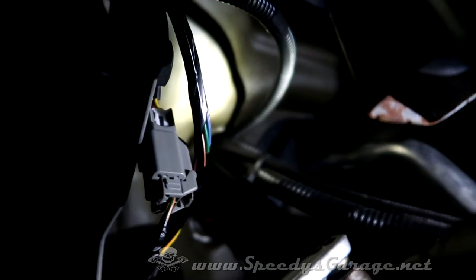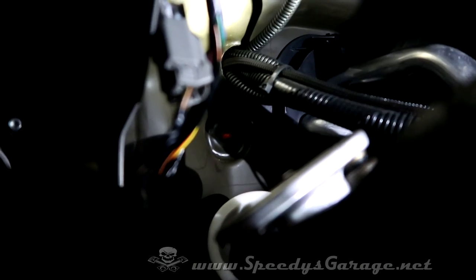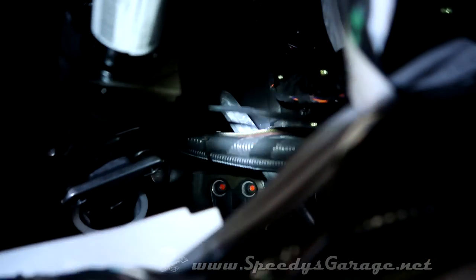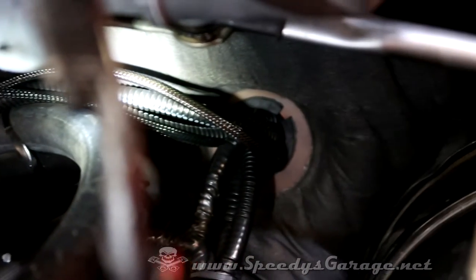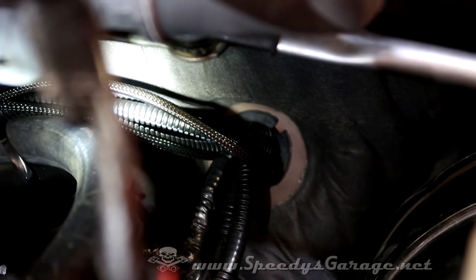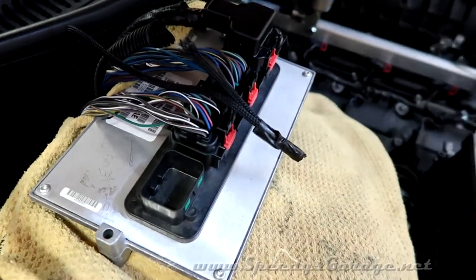Bending cables over will help them feed through the firewall easier, and I put a little bit of electrical tape on there to make it smooth so it'll feed through really quick. You can see there's a grommet back there by the firewall that I've used to run all my other wires — I'm going to use that same one for this. Pretty good size hole and easy to get to, right above the steering column so it's well out of the way. I routed the wire along the old ones, back and out the firewall, and it exits and follows some hoses over to the PCM. I went ahead and routed it all the way over so I knew I had plenty of slack to make my connections at the PCM.